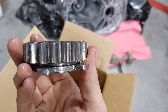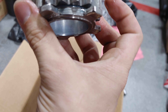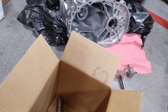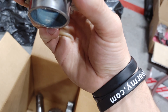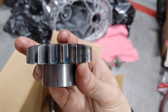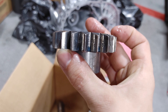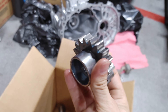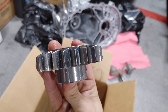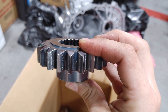It also had an issue — I think it was on the counter shaft — yeah, there we go. It had some delamination issues or something where the gear looked like it was about to rip apart. So I wasn't happy with that, so I replaced third and fourth gear in the transmission. Third just looked kind of rough too — it's kind of hard to see but it wasn't looking too good either.